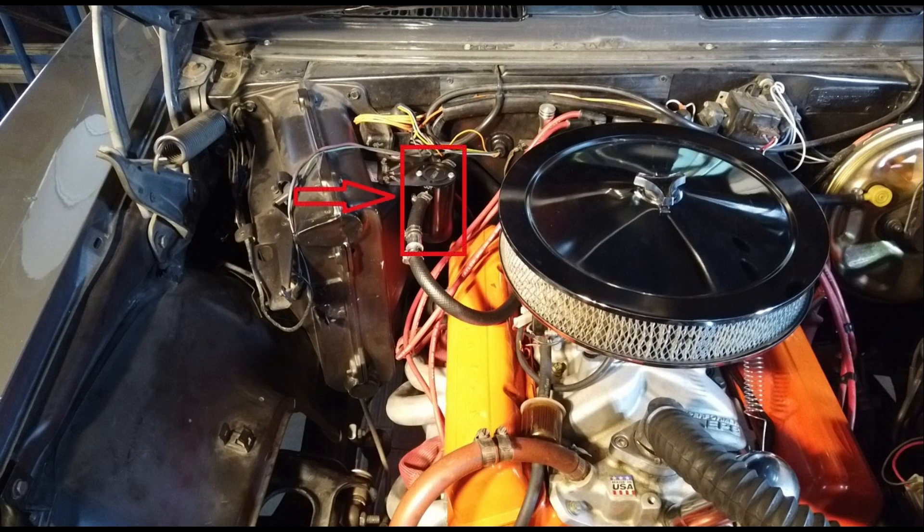Over here, attached to the heater core, you can see that I installed an oil catch can. The reason being is that this engine had a road draft tube on the rear, right behind the distributor. A lot of engines from back in those days seem to have it, and modern engines after '67 don't have it, and unfortunately I'm an unlucky one. So for a while I left it open just like a road draft tube usually does, and it was pumping out a lot of oil residue into my engine compartment — all over my intake manifold, and it was really bugging me. So I ended up installing an adapter where the road draft tube goes, and then to this catch can. Catch can goes to a PCV valve, PCV valve goes into the manifold. That's what I've been running in order to try to get rid of some of these fumes, because it was strong inside the driver's area.